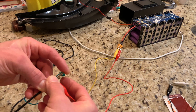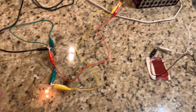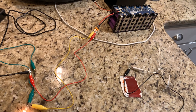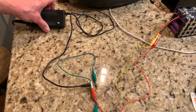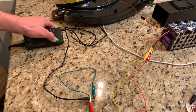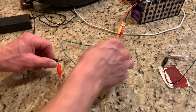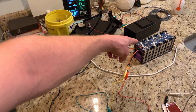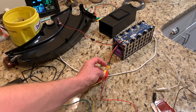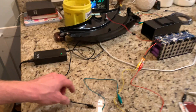As you can see my bulb is lit up and I left it that way for one or two minutes. The light was red before - now it's green, meaning the bypass gave it a little charge. Then I took it all apart. Essentially what I did was wire it in as if the battery was a bulb - positive and negative wired through the battery to the bulb and back to the jack.